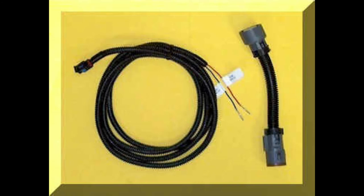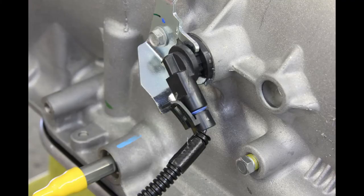A couple of odds and ends you're going to need: the 4L60 to 4L80E wiring kit harness. There are two parts to this harness. There's the thicker harness with a round plug on each side — this one is so easy. Once the transmission's in, it plugs on the side that used to be attached to your old transmission and goes between your vehicle and the new transmission. There's a plug right on the side, so it just snaps in. The other one is a little more involved, but don't let it freak you out — I'll walk you through it later.